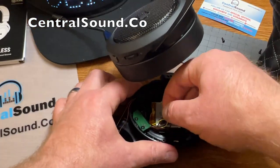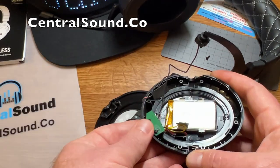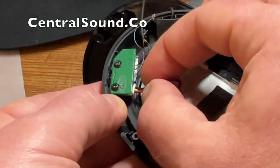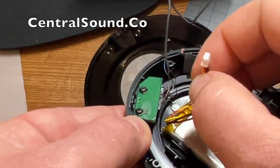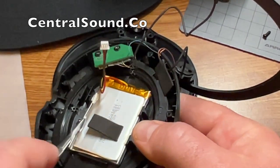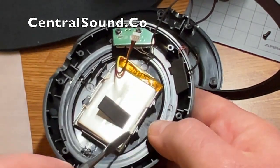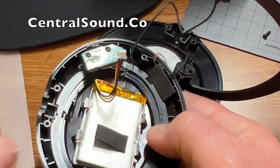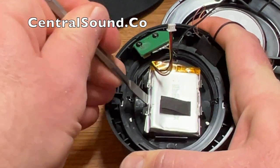You can untape the wire that's on the battery to loosen it, and then unplug the connector piece from the control board. Once it's unplugged, you can cut the small pieces of adhesive on the side if your battery has that. It comes off really easily — just use the pry tool, push on it, and it separates. Then use something to pry the battery up because there is an adhesive on the bottom holding it in place.